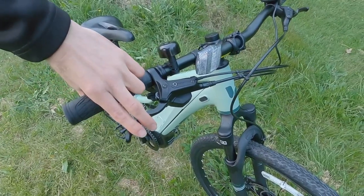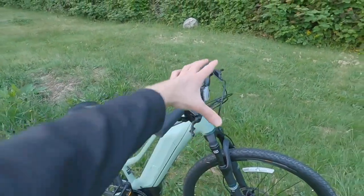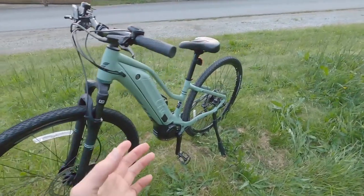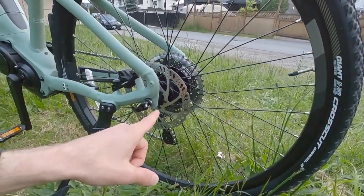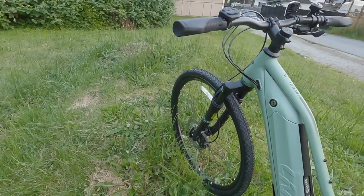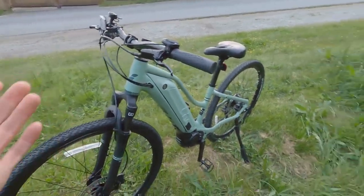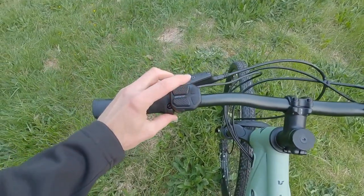The brakes are Tektro hydraulic disc brakes with two- to three-finger levers and adjustable reach, so you can bring them in for smaller hands — that's really great. Hydraulic disc brakes give you a lot of power and tend to be very consistent front and rear, unlike mechanical brakes where the rear often requires more effort. We have a 160mm rotor in the back and 180mm up front — the larger front rotor is important because weight shifts forward when stopping, and the greater surface area cools easier with better mechanical advantage. Both have dual-piston calipers.